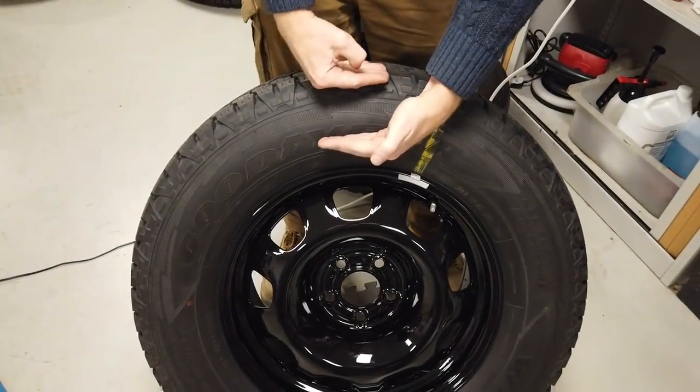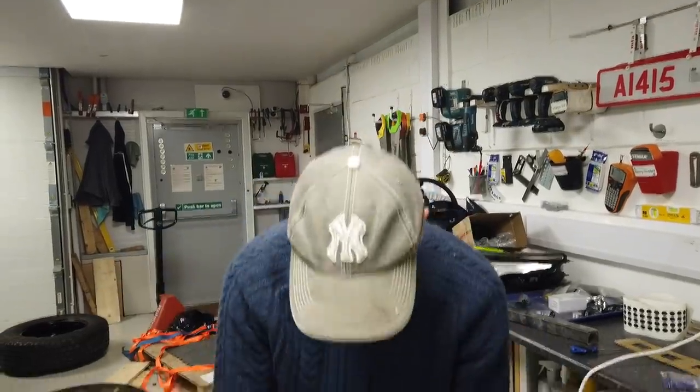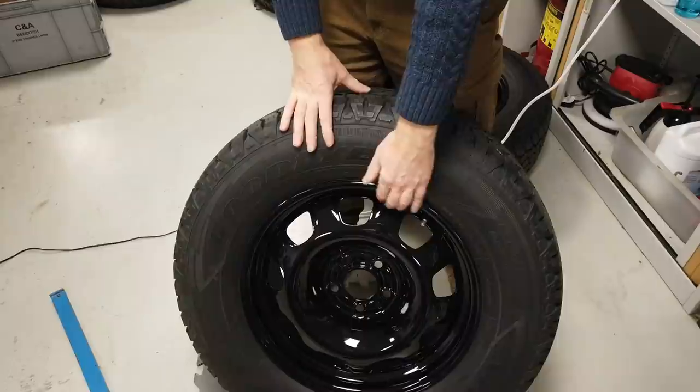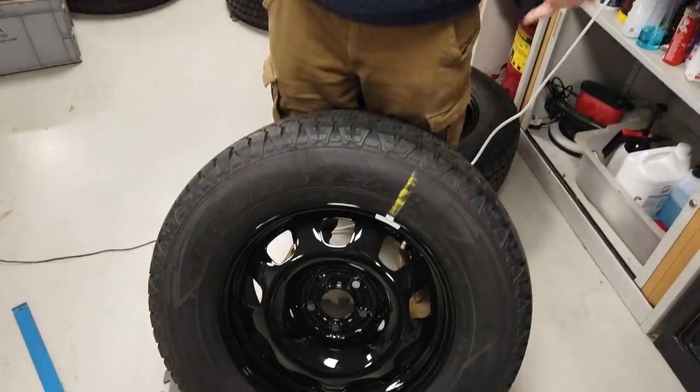But I don't want to go on low tyre pressures with my 20-inch alloys, because where you've got a bigger alloy, you've got less tyre. And if I let my tyre pressure down, the sharp angle on that step is going to go straight through the tyre and hit my rim. What I'm hoping is, with these 18-inch wheels, I've got a lot more tyre. I can let the pressure down. The rims are steel, so should be stronger and in theory less expensive than the alloys. And I'm going to need a compressor, because we're going to have to go to the off-road day, let our tyres down a bit, then get one of those little plug-in compressors.